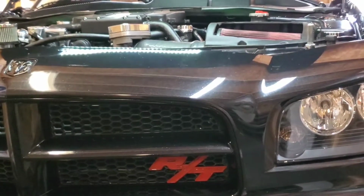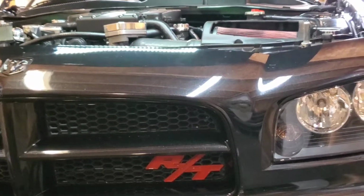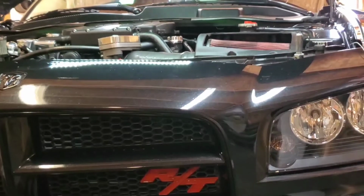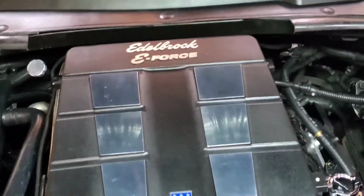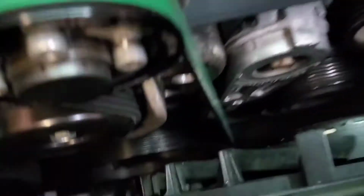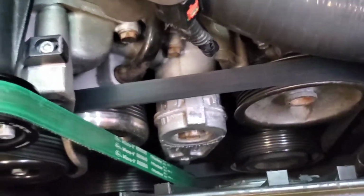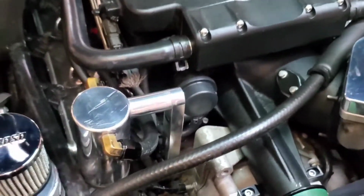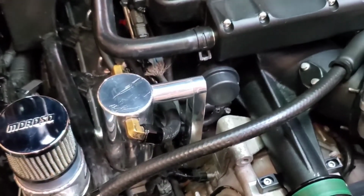The car for the build, there's not much left, without going super crazy and redoing everything. It's got the 2300 Edelbrock supercharger, 2.8 upper Grip Tech pulley. Then the Edelbrocks, some of y'all know, come with a separate drive. They got their lower crank pulley, so you got both belts. It's a pre-Eagle engine, 5.7. Stock displacement. This motor has not been bored, nothing. I've put drop-in forged pistons in it.